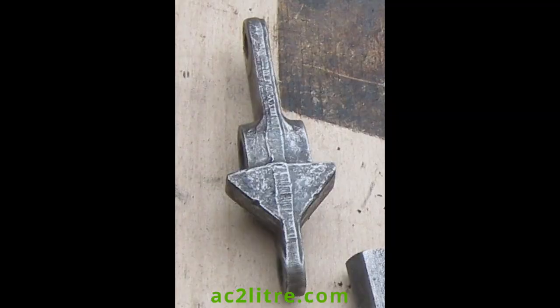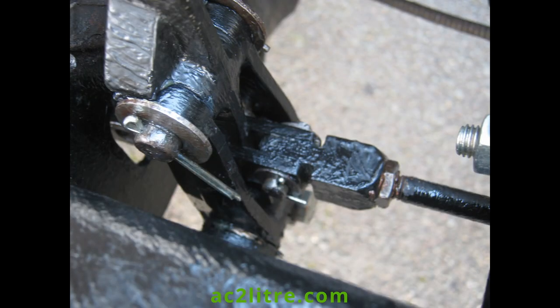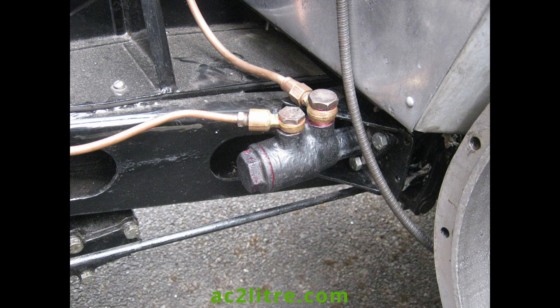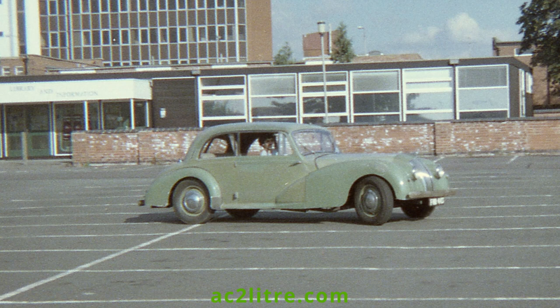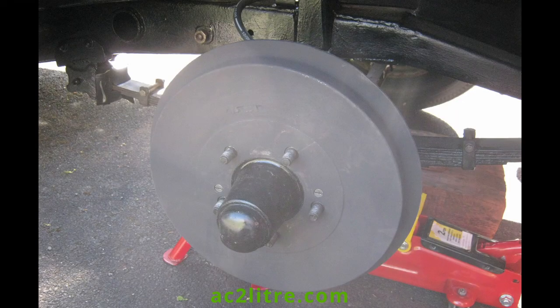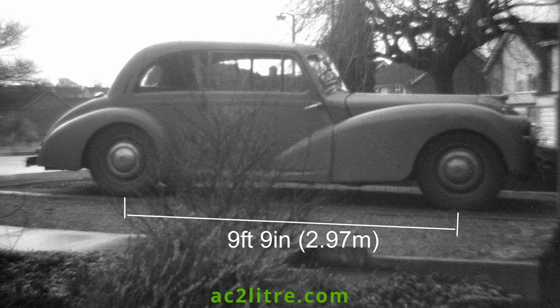There is a balance linkage near the pedal to distribute the load between front and rear brakes, but I worked out how this can fail to function. The balance link is normally vertical, connecting to the master cylinder at the top and to the mechanical rod at its lower end. However, if there is a very large amount of slack in the rear linkage, the balance link tilts until it can activate the master cylinder without doing much with the mechanical system. The annual MOT roadworthiness test failed to reveal this because rolling roads only test front or rear brakes at a time. The AC has a rearward weight bias, a long wheelbase and a low centre of gravity, meaning it makes more use of the rear brakes compared to most modern cars.